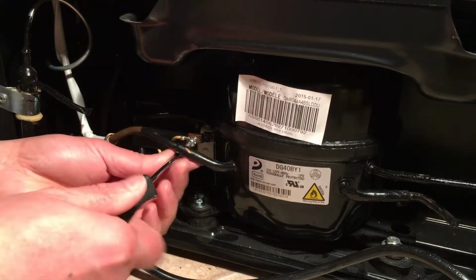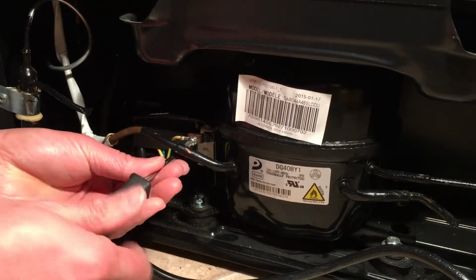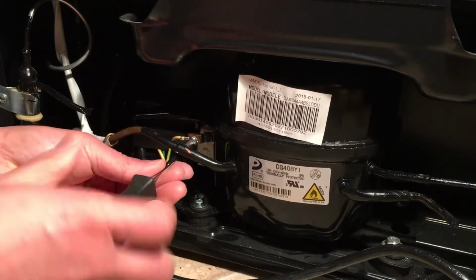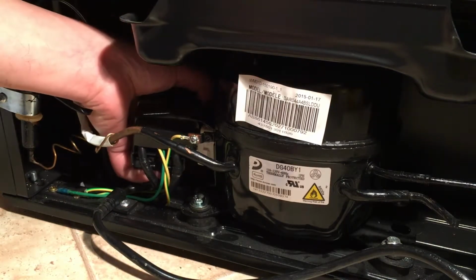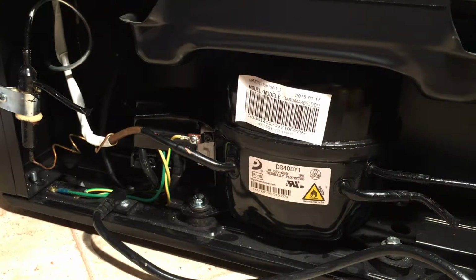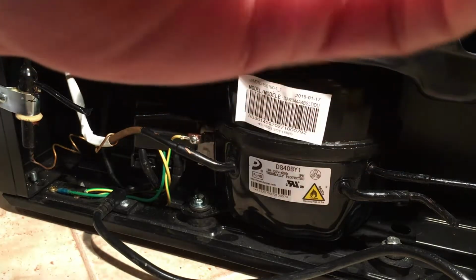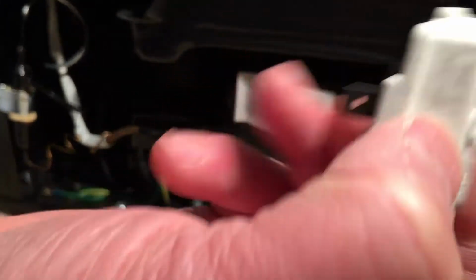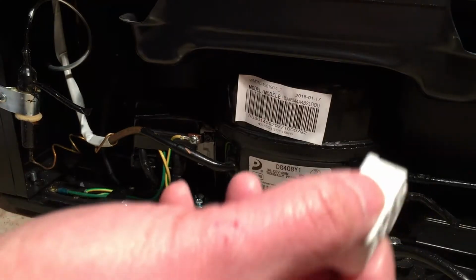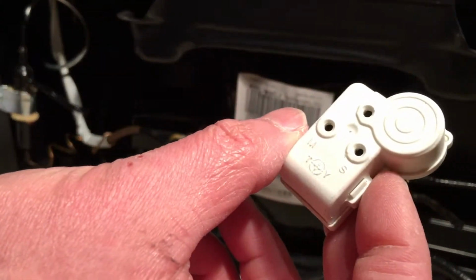After you plug it back in, you screw the yellow wire back to this position. And the next thing is, well, first of all, you can tell a relay has turned bad by shaking it. If you hear a little bit of clicking noise, it means the relay has gone bad, and usually this is caused by electric surge.